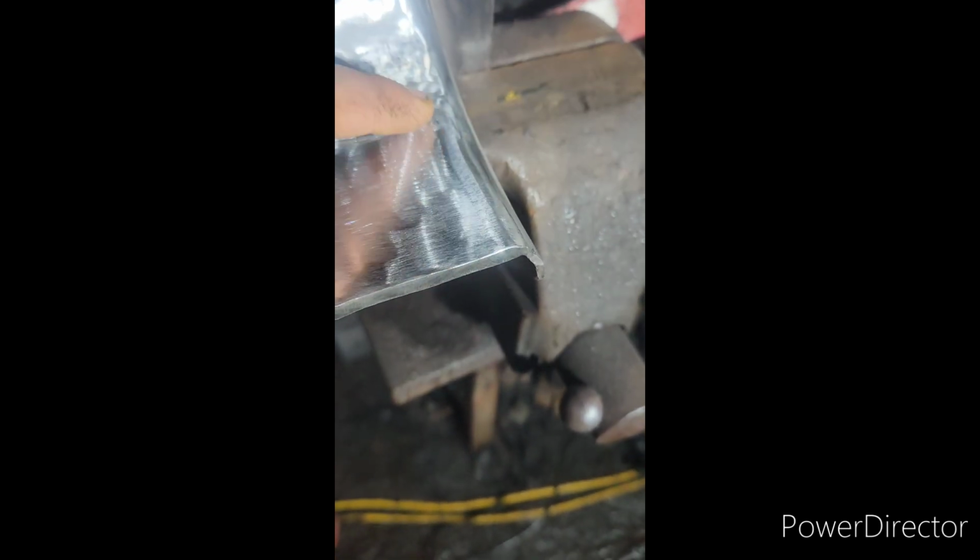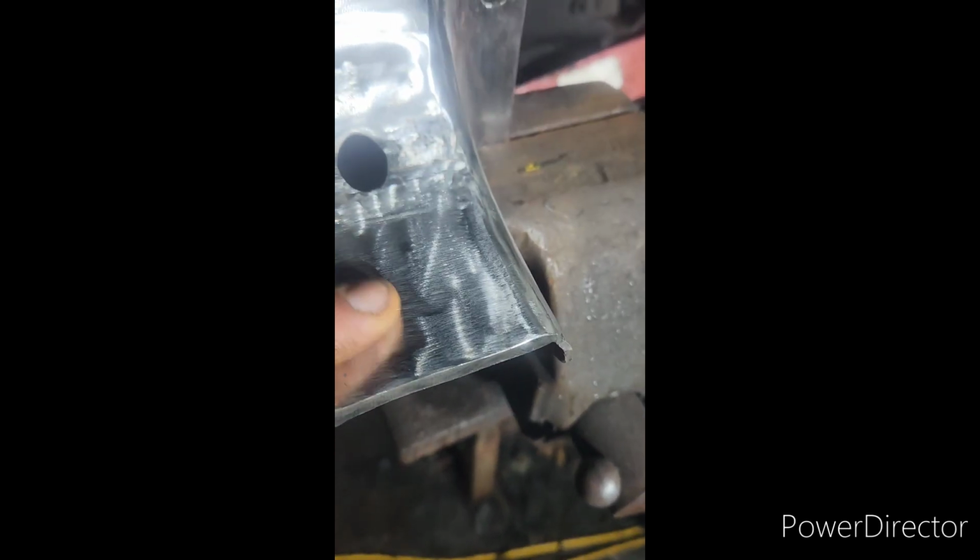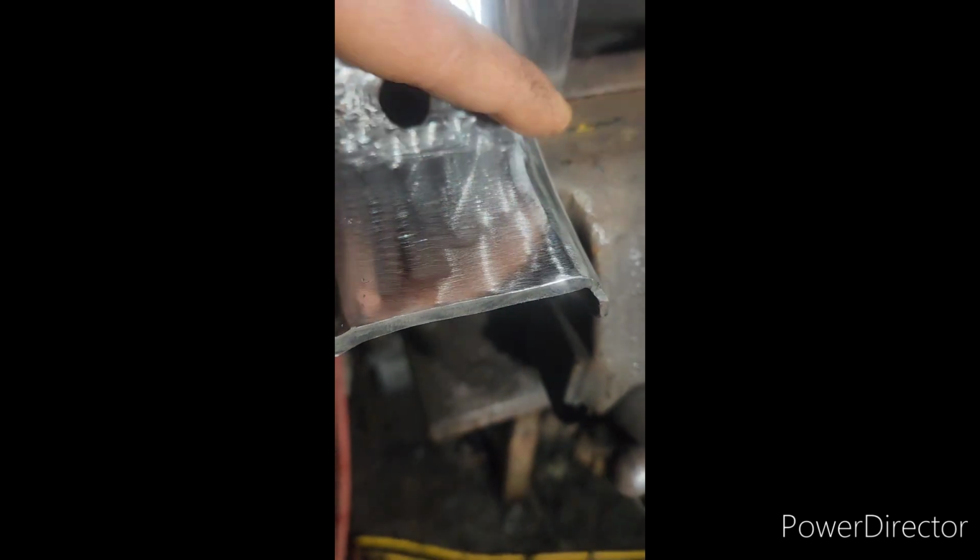The piece I added was 1/8 inch, but when I put it in here, it wasn't level because I didn't check level on here or on the other bracket. So I had to fill this. I filled some this way. I ground it down flush so I could measure how much left I had to add, because this side was low. I bolted it up to the truck using some regular nuts that I had to go back down to the hardware store to get, because I only had the lock nuts. So I could fit it and measure it from the frame down and compare it to the other side. Then I did a bunch of beads, bead padding back and forth this way, one this way, one this way, so on and so forth, and then leveled that and then went in and filled all the butt cracks.